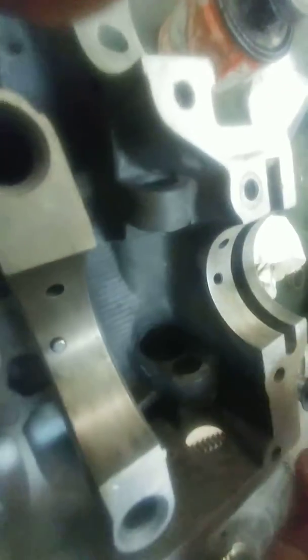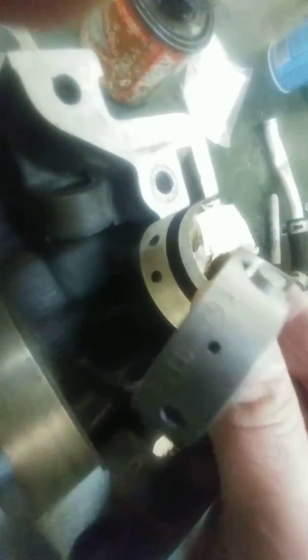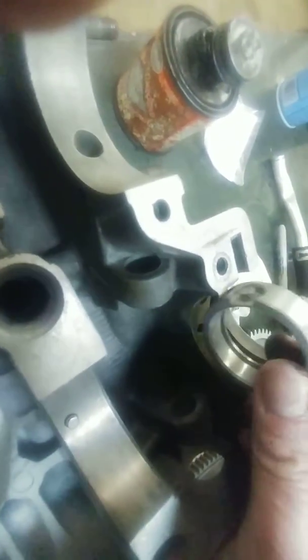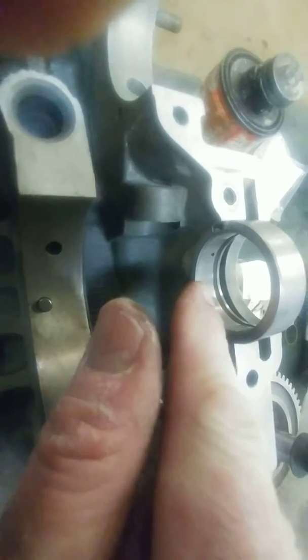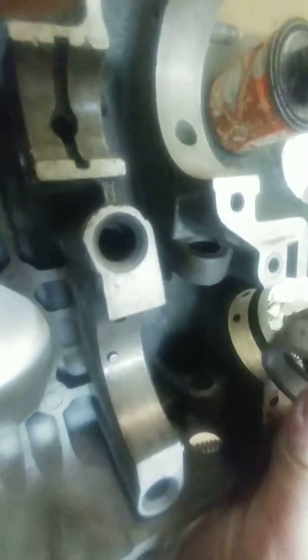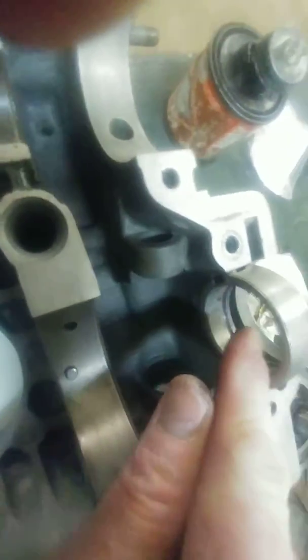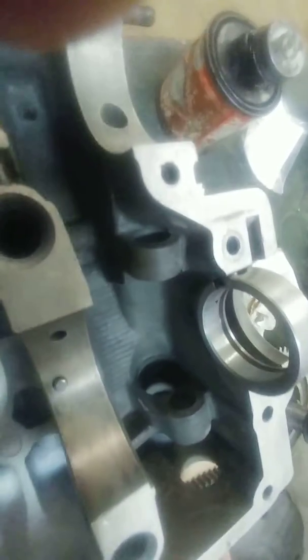The front bearing you never modify because it's a restrictor-type bearing. If we put the pin in location - there's a pin facing back - you can see the large oil hole right here and we have a little tiny one right there. This hole is the pin location and this hole is the oil supply. When I put that in its correct position, the little hole pins the location, and then the oil comes up into the journal area and dumps the volume out through this part of the bearing - you can see the hole, it's like a D-opening. It also has an annulus groove all the way around the outside of that bearing to hold the volume of oil for lubrication.